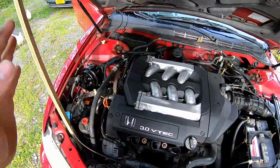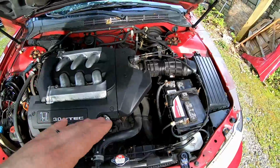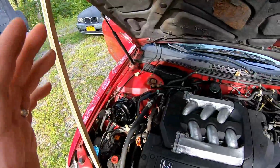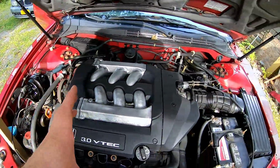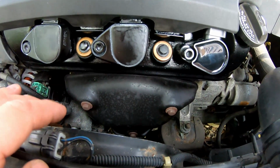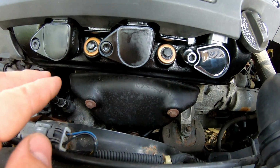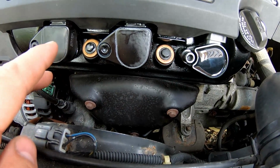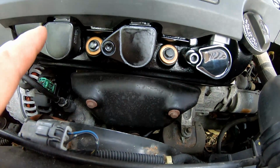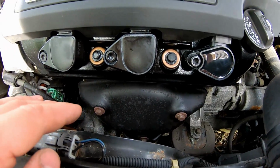Now, if you're going to take any advice from me and it's going to stick, do me a favor. Something my papa told me, and I stand by it on all my projects, is if you're going to do it, do it right. It's very important. Not only do you make the engine bay look good, I painted the heat shield. Some people might ask, why are you going to paint the heat shield? That paint is good for 3,200 degrees Fahrenheit. It's a ceramic paint that they use on the inside of wood stoves, and I've put it on headers in the past, and it doesn't get burned off. It's very hard to get. It's not something you can just find. You do have to actually look for it.